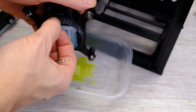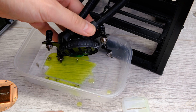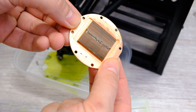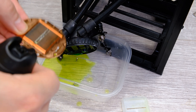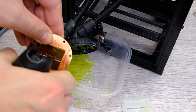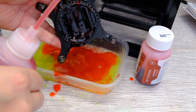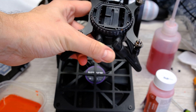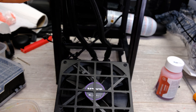Take a moment to note the way the coolant director nozzle is aligned. The next step is to clean the contact plate — as you can see there's loads of stuff in there. A couple of ways to do this: you can use an air duster, or just flush through some high-pressure water from a household tap. Don't use any kind of metal brush because the fins in the contact plate are extremely fine and you could damage them. Here I'm flushing the exterior of the contact plate with coolant made up using EK Cryofuel and some deionized water, then doing some more flushing and draining as much coolant out as possible.